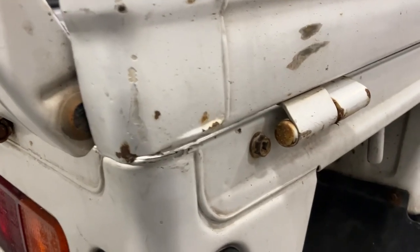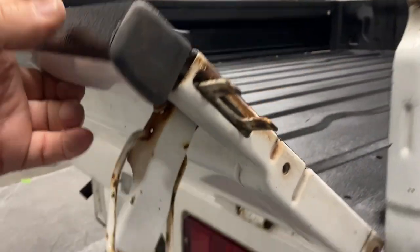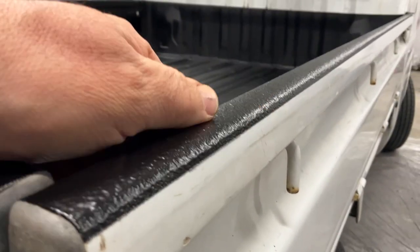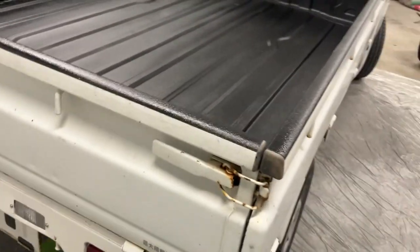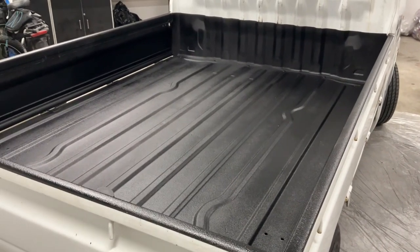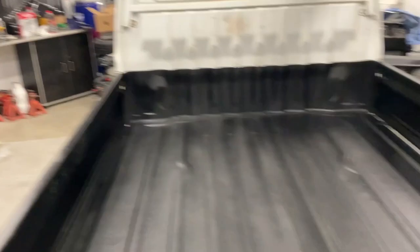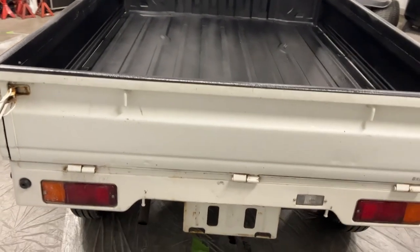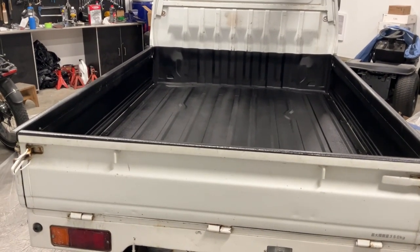Don't forget to tighten up your bolts after you install the bed sides. When you mask it, keep the inside of the tailgate as-is — you don't want to paint that. But it goes together beautifully — looking from the outside there's no overspray, and I wrapped it around the top of the bed rail so there's wear resistance all the way around. Overall, I give it a 10 out of 10. It's a fair bit of work — a lot of sanding and masking — but you could just mask along the top and spray it in if you want. I took the time to make it look good. If you want to do a spray-in bed liner on your Suzuki Carry, it's not that difficult and the results are pretty satisfying. Thanks for watching.